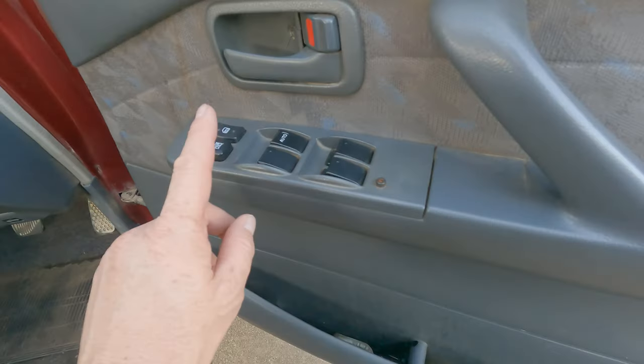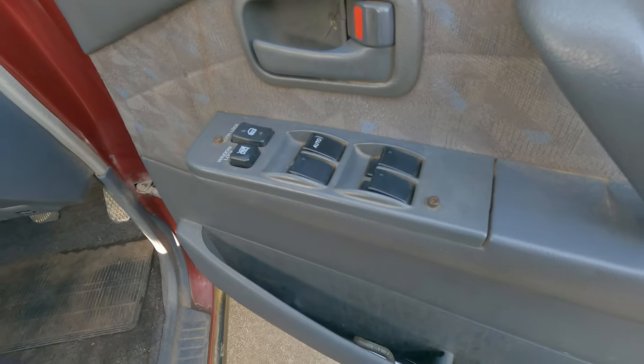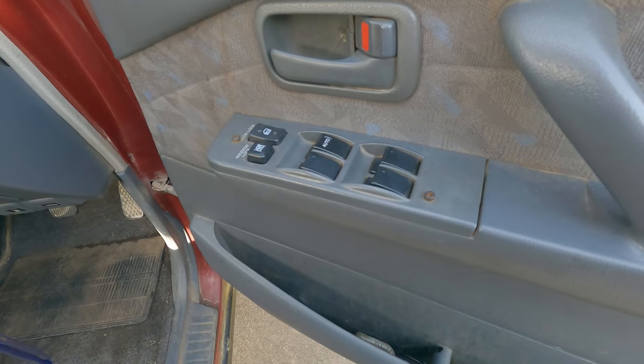Okay, ladies and gents, in this one, I'm going to change the electric window module on the driver's side of the 80. It's been giving me a bit of grief for a while now. I replaced all the switch and it wasn't that. I've tested all the wiring. It's all perfect. So it's actually the motor that's failed. So I did replace the switch, guys, under there. It's a brand new one and it's not that. So now we've got a spare.